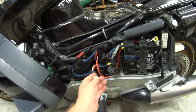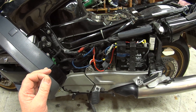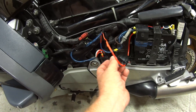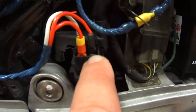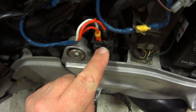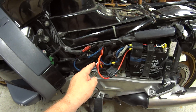Now, the crimp that Honda uses is a fairly standard crimp on what I'd call a spade connector — these flat bits here. But the surface area of that contact is minimal, and there's a lot of power flowing through there, to the point where it actually melted — hopefully you can see that.